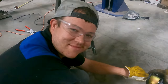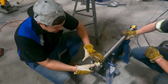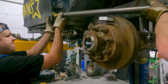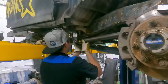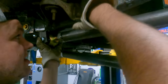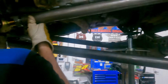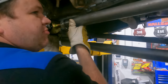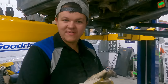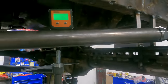Third time's a charm. So we got these brackets cut and I think they're gonna work awesome. They're even notched right here so they can go around the frame a little bit — we'll be able to penetrate-weld them. We're gonna put these up in there and see what they look like. If we drop the axle down a little bit we can get these level and should have four inches without binding. That's perfect. Once we get the two upper links in, it's time to articulate the front end. We've almost got this Bronco four-linked and I'm pretty excited.